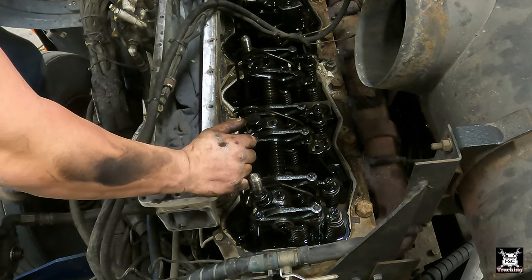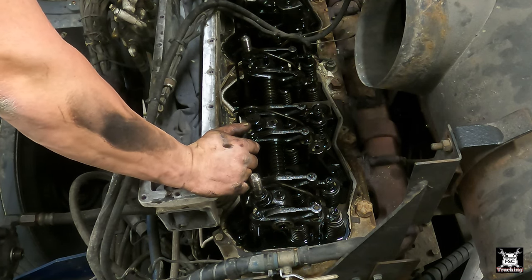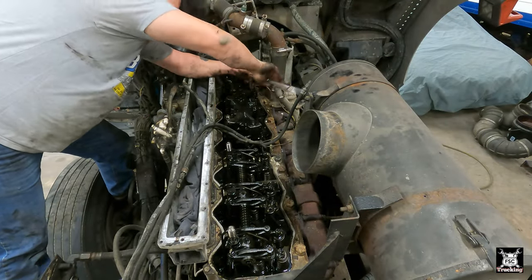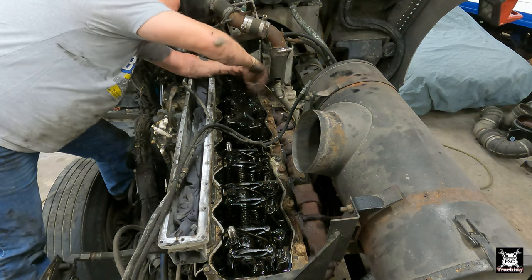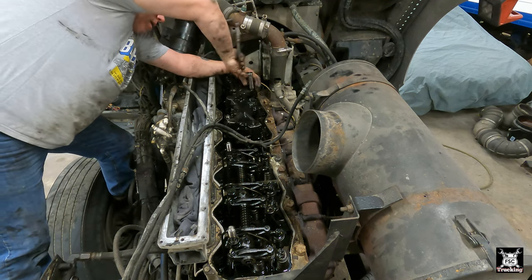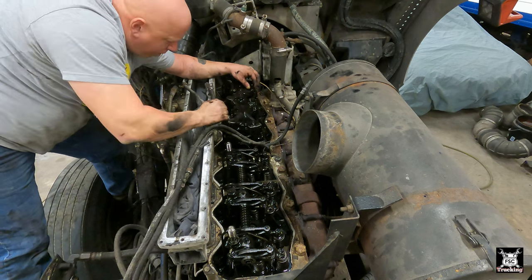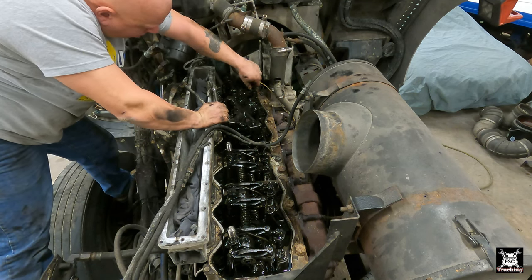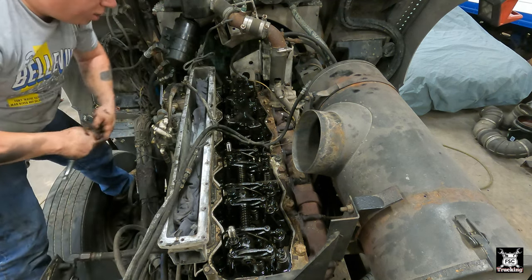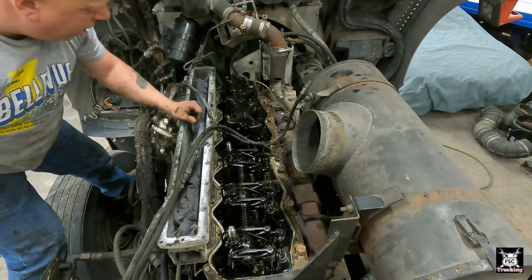That's it. I mean, bear in mind, these engines were designed for Jake brakes to be used or not to be used. They didn't come factory with Jakes. That's the 5/8. Now bear in mind, everybody, Caterpillar built engines, but they did not build the Jake brake. The Jake brake is actually just a brand of engine brake, Jacobs engine brake. We just nicknamed it Jake brake, but it's the Jacobs engine brake company that made these. Long in the front with the washer. This is where you must be careful not to drop crap in the engine or you'll be fishing it out of your oil pan.